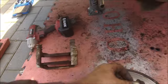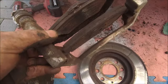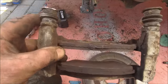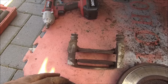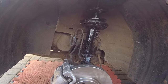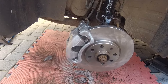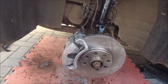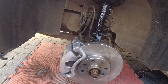That was a pain to get off again, and as you can see the disc wear is much worse on this side — slightly unequal, and that's again because of that seized slider. The pads were pretty much stuck in there too — pretty much solid. Right, clean up and get on with it. And there you go: side two professionally rebuilt — well, something like that — and painted. New springs, new discs, new pads on the front. I might just call it a day on the rears — it's a lot easier than the front but maybe another day. Can't spend your whole life working.